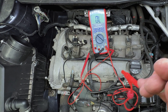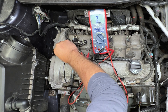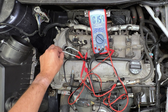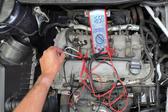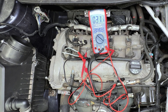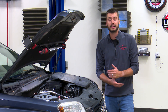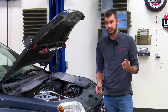Beautiful. Now I'll stick these leads on the intake solenoid on the vehicle — the one that is not setting a check engine light — and just wiggling that back and forth is giving us widely varying readings. So really, this vehicle needs two variable valve timing solenoids. Nothing too uncommon here. VVT solenoids on the GM 2.4 are super, super common. Intake solenoid is the gray connector; exhaust solenoid is the black connector.